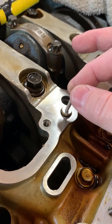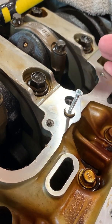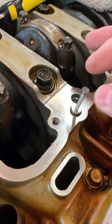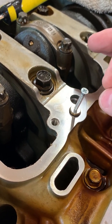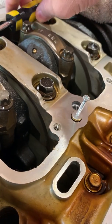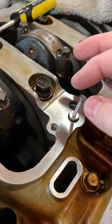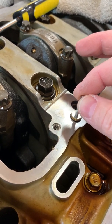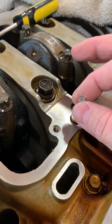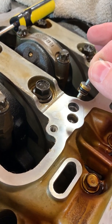Not just with the stock plug — you have to pull that out so it sits flat down in there. You're not going to get down there with a fingernail, so what we did is there's a tiny little hole at the very beginning and we got a really fine wood screw, because you want something with as fine threads and as sharp a point as possible. With good pressure on the screwdriver, pushing down really good and letting it bite in, you'll get to a point where that plug will begin to rotate. You won't be able to get much more, but you should have pretty good bite and you can just pull it out with a pair of pliers.